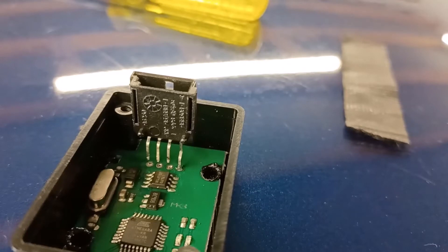In the 116 trophy class you're not allowed to run a steering lock, so what you do is remove the unit and replace it with a small emulator. This is the emulator unit, and you can clearly see that some of the pins — three of the pins actually — have pulled where I've disconnected it. They've pulled out of the circuit board and they obviously weren't soldered correctly, and this seems to have been the cause of my issue.